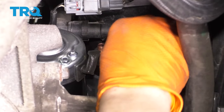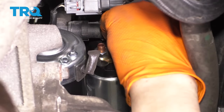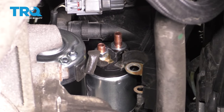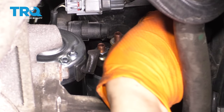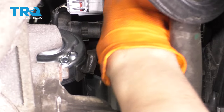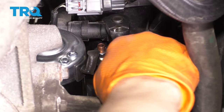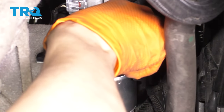Make sure your electrical connections are clean. Take off the nuts you need in order to connect things. There's a lock washer on this one — take that off because it goes between the nut and the connector. Take off this lower 10 millimeter nut as well, which also has a lock washer. Take your wires and slide them over their corresponding studs. Put on the corresponding lock washers — that's going to help keep those nuts in place. Start on the nuts and snug these two up. You don't have to go crazy on these; they are very delicate and can actually break off internally inside the starter. So once it bottoms out, give it a little snug and just stop right there. Bottom that one out as well, give it a snug.